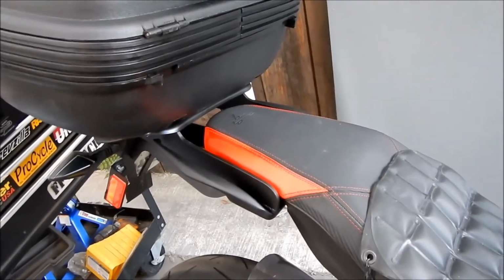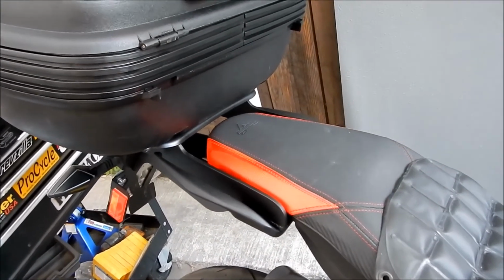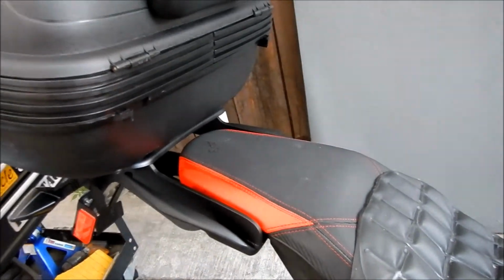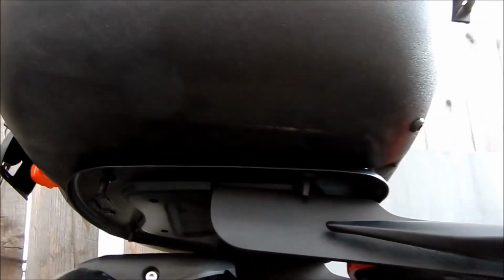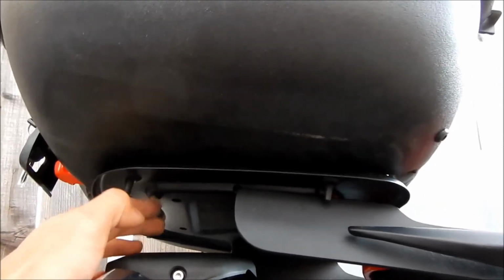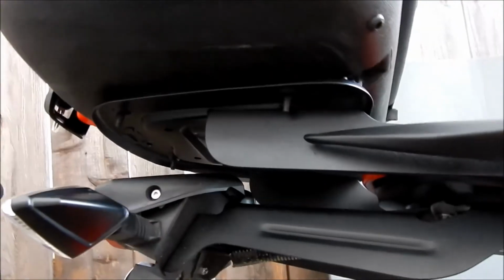But it must be super strong. But I think if we had to do it again, I would make it aluminum, but the same thickness. A quarter inch aluminum is pretty strong. But yeah, I guess the problem is he welded it to the deck, so it's all one piece. He'd have to make it bolt on. He'd have to make something for it to bolt onto. That's the original way this deck was supposed to be going on. You're supposed to bolt it on with some bolts, and there's some metal you can sandwich with.